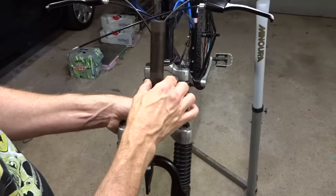I was lucky this bike was set up with a 1-1/8 inch steerer because there are plenty of disc-brake-ready forks available with 1-1/8 inch steerers. On some older mountain bikes — most of the older ones — they're going to have 1-inch steerers. If you have a suspension fork with a 1-inch steerer, that might be a roadblock. It's going to be hard to find suspension forks with 1-inch steerers that are capable of disc brakes or even wide enough to fit a wheel with a rotor, so that is going to be an obstacle.